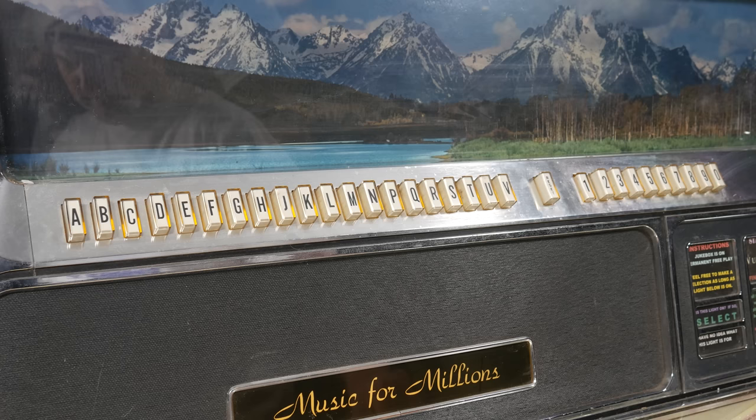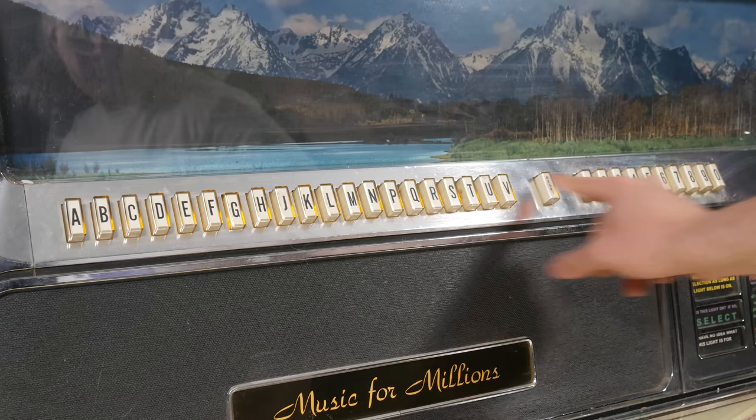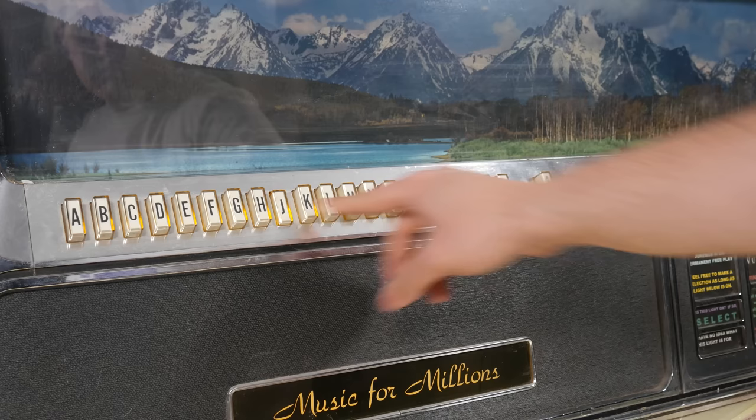But then, of course, when it's done with its sweep, we need the buttons to pop back out so another selection can be made, and that's why the inner contact patches will briefly pulse power to that relay to disable the latch solenoid and reset everything.